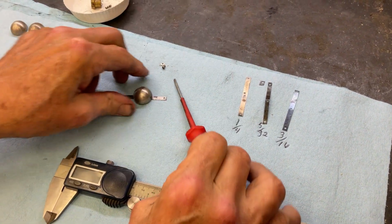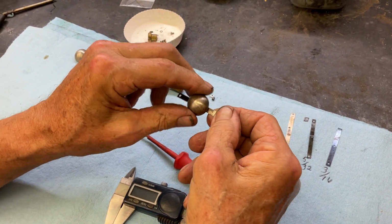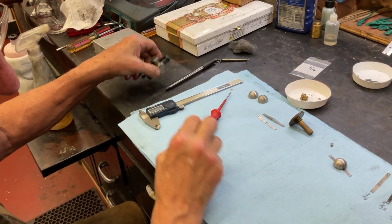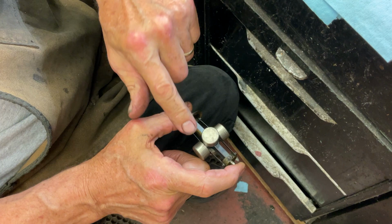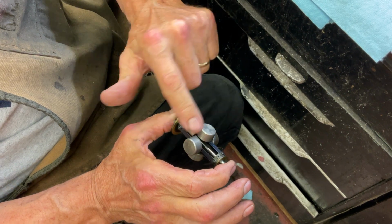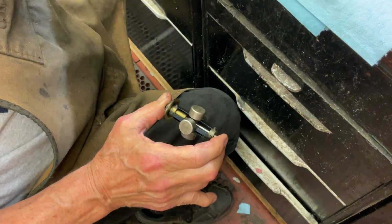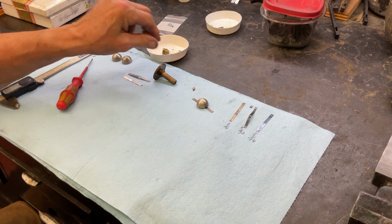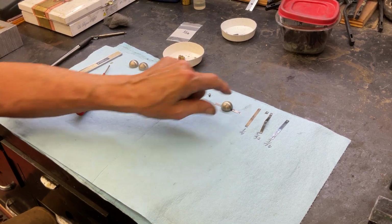And what this causes is when the governor engages, the weights come up like this. So we'll take this 4-spring Edison A1 governor and I'll show you. When you look straight down at it, and we have the balls, don't worry about the force balls. When you spin it, you look at the outside. You see how all the weights are running the same. So if you have a bad one, it's going to be popping out like this. And that's what that weak spring causes. You can't put a little spring with a big weight. Little springs have little weights. And this happens a lot.